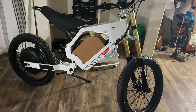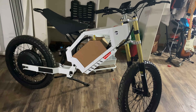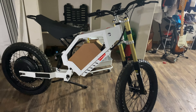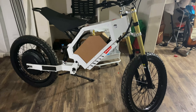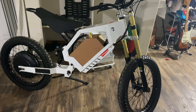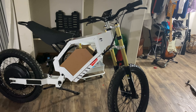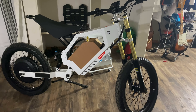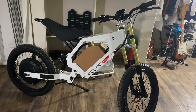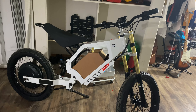One question I was asked is how powerful is this bike going to be? It's 72 volts by 150 amps, which is about 10.8 kilowatts of power — roughly 11 kilowatts. That's pretty big considering that my Zero 10X puts out about 3.6 kilowatts and a Suron puts out about 5 kilowatts. Those are two vehicles I've made a lot of videos on, so this is definitely a huge upgrade in terms of power.